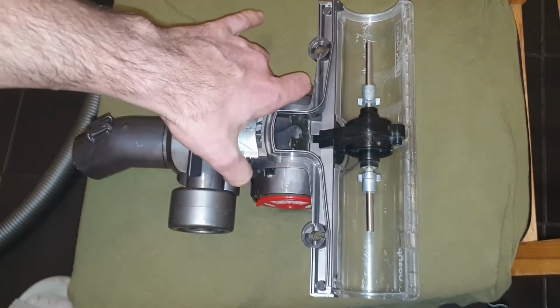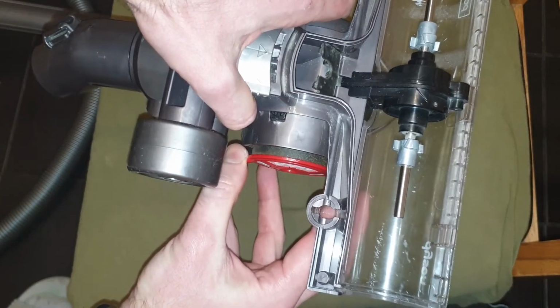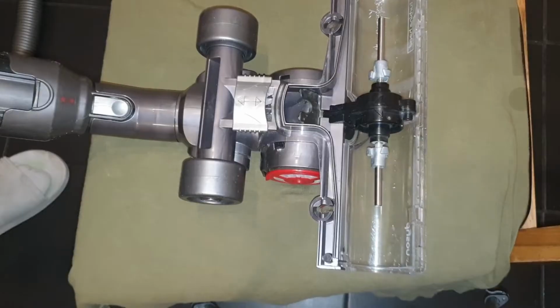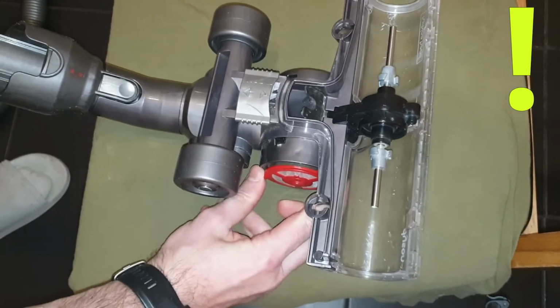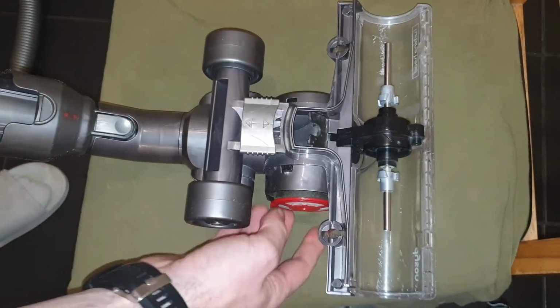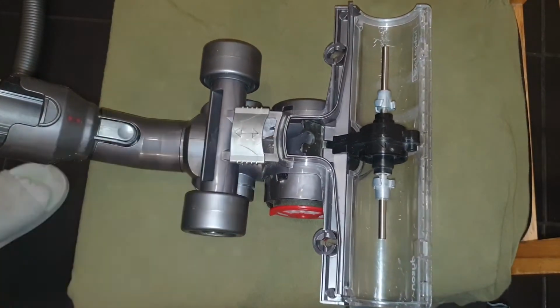The next thing is the valve. This valve should be open fully, like this, and the air should freely go into this hose just to spin the turbine. Even though everything may look right, it can spin freely and the valve could be open, it still can spin very slowly and unpowerfully. I will demonstrate the reason for that, especially if you test it in this condition.